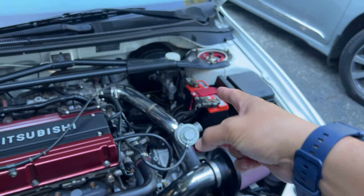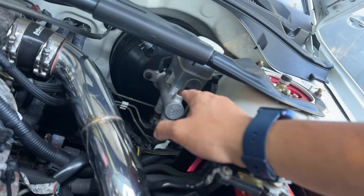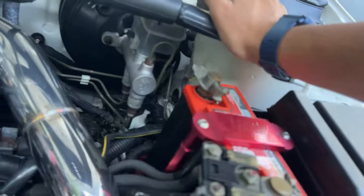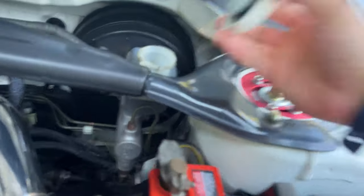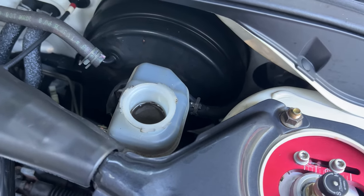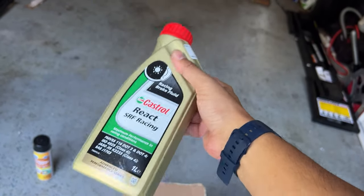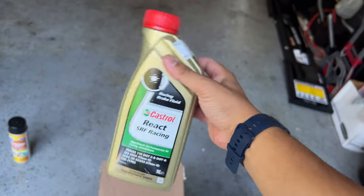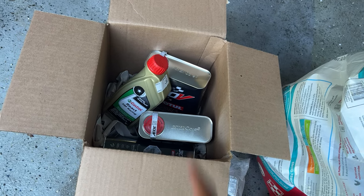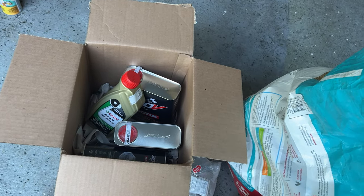The other things we have to do: fluids. The brake fluid definitely, definitely needs to be changed. Here is the brake master cylinder reservoir, and just like the Type R, it shares the reservoir for the clutch master cylinder. You can see in there how dirty that brake fluid is — basically pitch black. This is the only track brake fluid that I'm running now: Castrol SRF. I get this from FCP Euro, it's about $94 per bottle. Because you buy from FCP Euro, you send back your old fluid after you purchase the original one, then you make a second order and get store credit. It's lifetime free replacement.